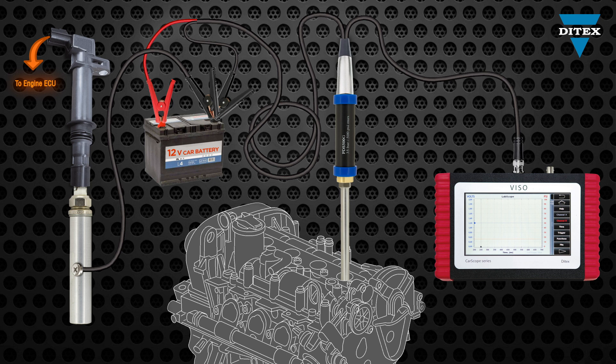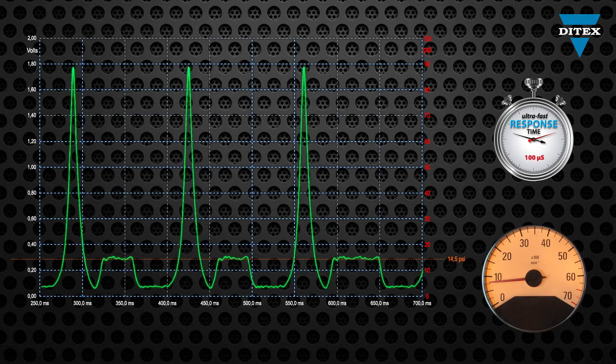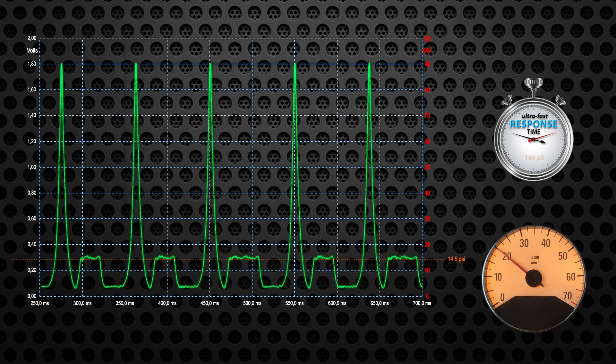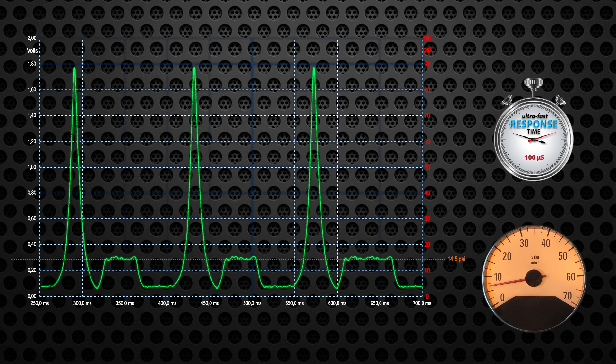After everything is set up, just start the engine and examine the pressure waveform. Analysis of the cylinder pressure waveform on a gasoline engine makes it possible to determine the proper synchronisation between the crankshaft and the camshafts. Measurement and comparison of cylinder pressure values at certain points provides real-time data helpful in determining engine health, and also allows you to assess the condition of the exhaust valves, detect clogged exhausts, intake vacuum and timing belt issues.